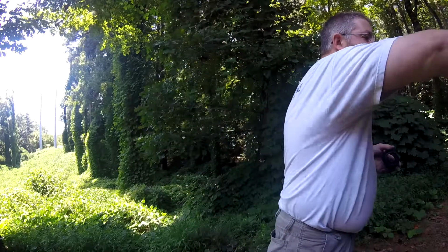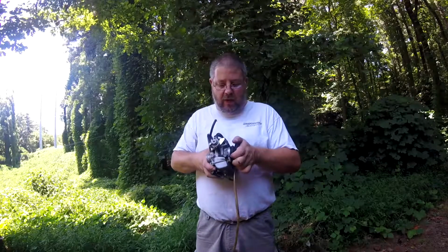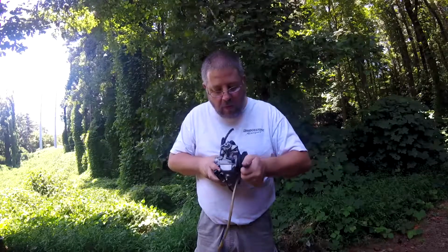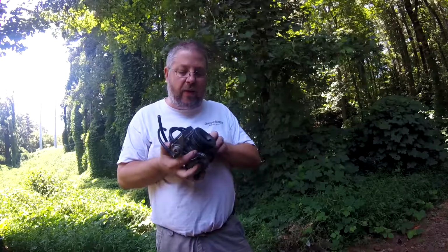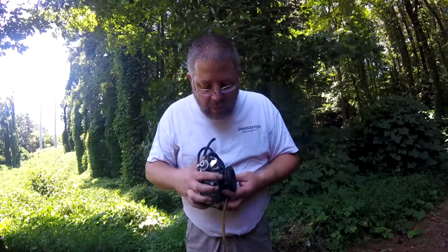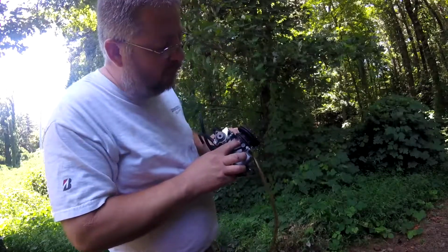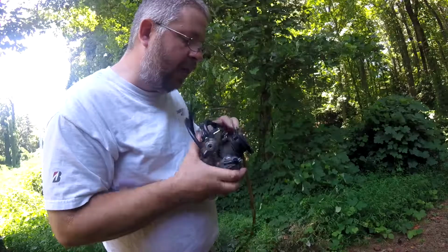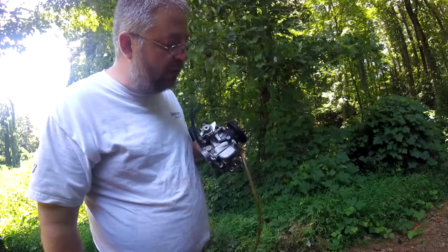If you have good boots and you went and bought nice fresh ones to do the job with, then when you get your carburetor in there and you get that boot on there like that, okay, again, that's not sitting right. I see that, but again, the nice new fresh boots will. When you get your nice new fresh boots on, just take your fingers, take that spring and rotate it into the forward position. Just like that. It really is as simple as that, guys. It doesn't have to be hard. You don't have to make it hard on yourself.